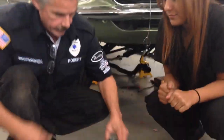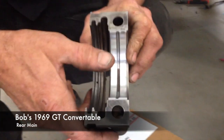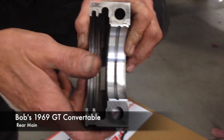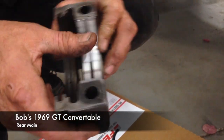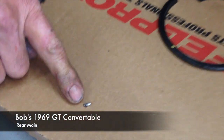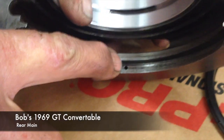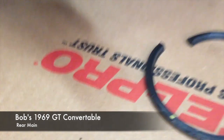Okay Bob, there's a rear main. The bearing's fine — the motor's been broken in, it's only got maybe an hour of running time on it. No problem with the bearing. What I did find is that little pin right there goes in the cap — the rear main cap right there. That's for a rope seal, that's what they came with from the factory.